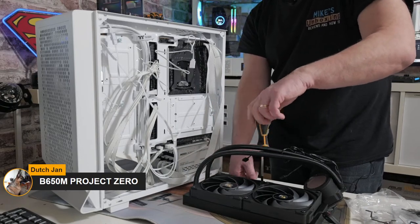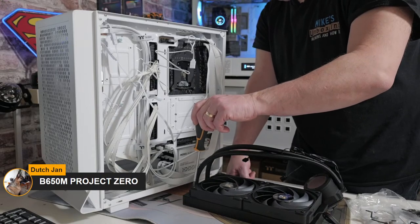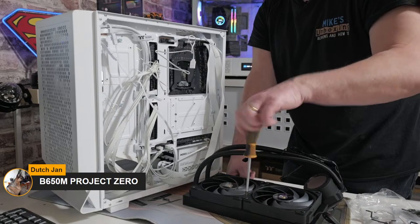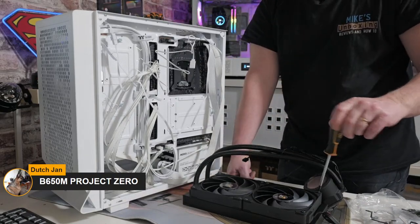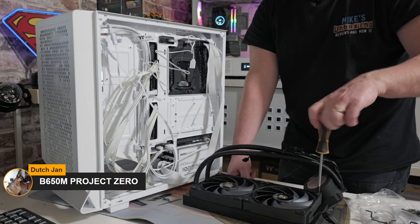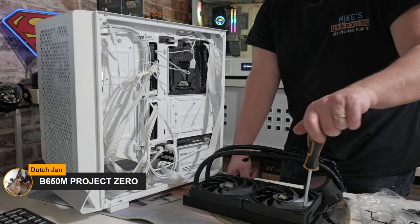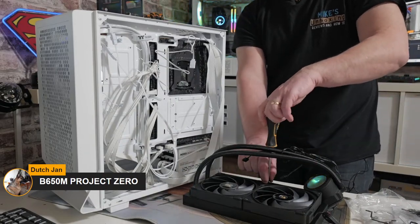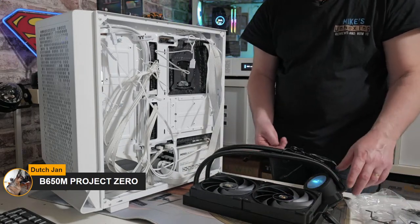Uses a 1080p monitor. That's helpful. So 1080p is going to be your limitation. 1080p is going to bottleneck your processor pretty hard if you've got a fast graphics card, because your CPU is going to be struggling to generate enough frames, unless you go for ultra settings. So that is going to give the GPU a little bit more of a load rather than the CPU. Although saying that, the CPU is going to get somewhat of a load as well.